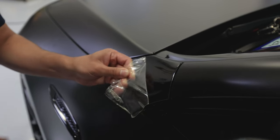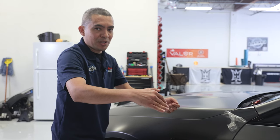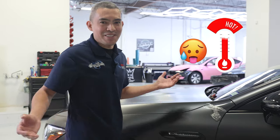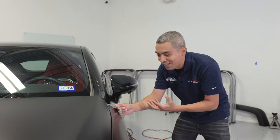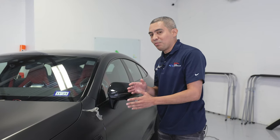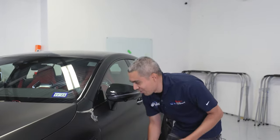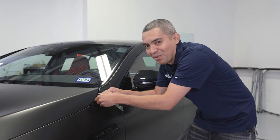It's coming off nice. I really like that paint — it is super glossy. One of the reasons I like to remove PPF and wraps outside is because while I'm peeling this little by little, every time I stop it leaves like a little line of glue, and that line of glue you're gonna have to go back and clean later. So if you do a bunch of lines as you're going, you're gonna have to clean a bunch of glue. Overall it's coming off clean, but it could be even easier if you parked it outside in the sun — especially in Texas, we have 100 degree weather. I'm gonna keep peeling with the heat gun, nice and slow. One thing I do want to let y'all know is that when I got this car, I literally PPF'd it one month after it was made, so the paint was super fresh. You want to PPF your car right away, but you also want to make sure the paint is at least three months old before you do it. I did it right away, so we're gonna see what happens. As of now it looks clean — I really like the way this paint looks, it's super shiny. I almost want to keep it like that, but I gotta wrap it. I'm a wrapper.